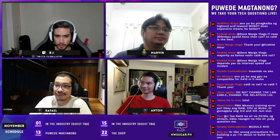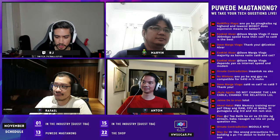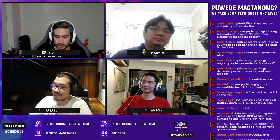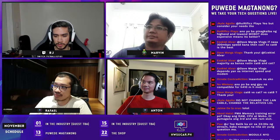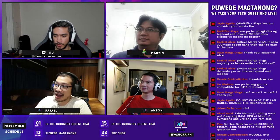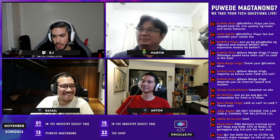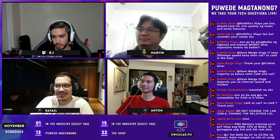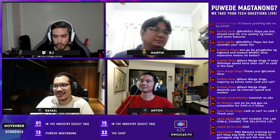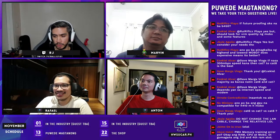So his other question was about size. Having two different sizes won't matter. I remember helping out Rocky more than a decade ago, he had one 4 gig and one 8 gig stick, and 12 gig worked as long as you have 64-bit Windows 10 or the latest Windows. It can go above the 4 gigabyte cap of 32-bit Windows.